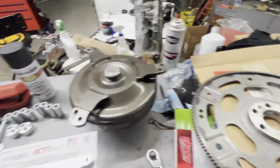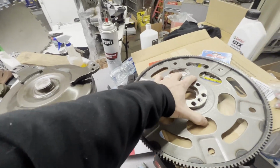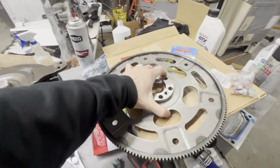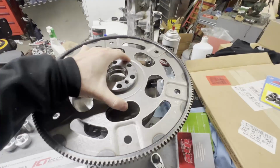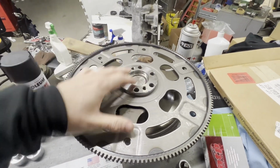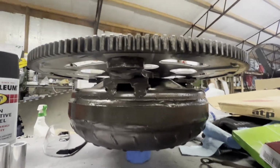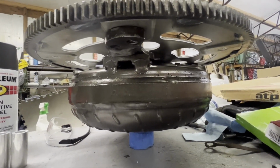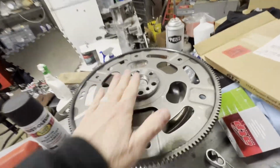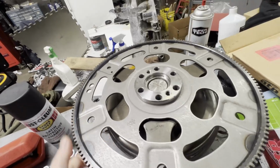And what you notice, my torque converter is turned upside down. The reason I did that is if you watch Sean from Mountain's Garage, he has a good point that you need to check your flex plate to torque converter clearance to make sure you don't have any issues. And as you can see, my flex plate sits right down on the pads of my torque converter. So I know that this is not going to hang up under the truck or bind in any way.